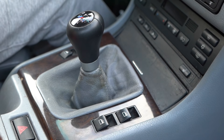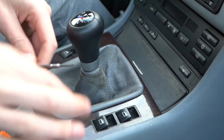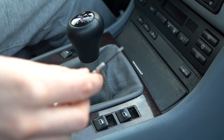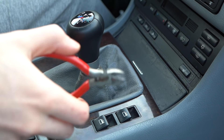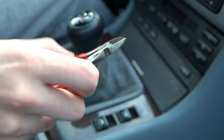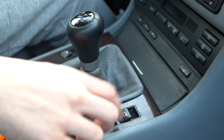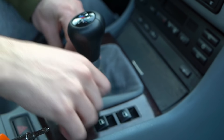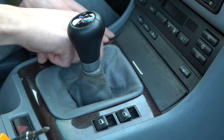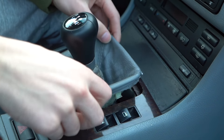The first thing you're going to need is a Phillips head screwdriver, a tiny little screwdriver to pick out the plastic piece. I'm going to use a pair of wire cutters to snip the plastic — a lot of you use Dremels, but I don't have one with me. I already tested this on my driver's side and it worked, so I'm going to show you on the passenger side. First thing you do is just pop this trim piece off — put your fingers in it, bend the plastic a little, and it will pop off.